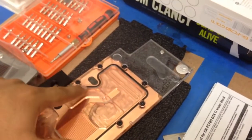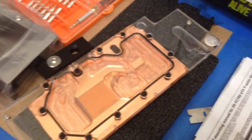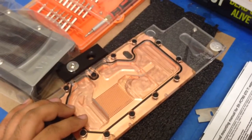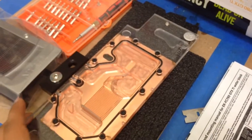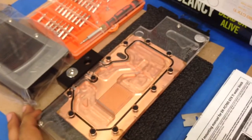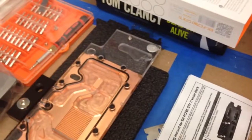With models like the Hydro Copper from Swiftech, the water goes through here and around the GPU, but the VRM area is pretty much passively cooled. That's not necessarily bad, but when you're overclocking, you get a lot more stability and better cooling performance from this block. It may not be the best looking, but it's the one that performs the best for VRM cooling.